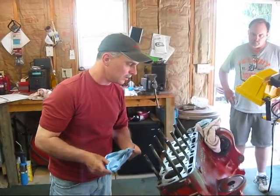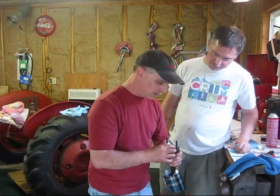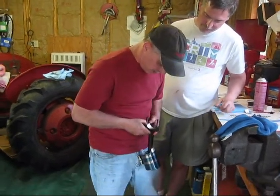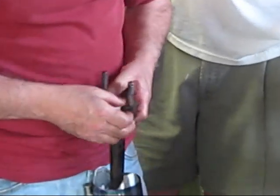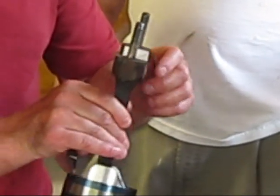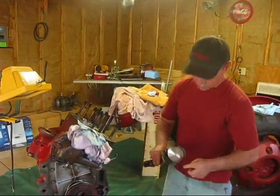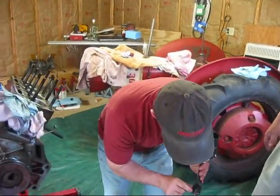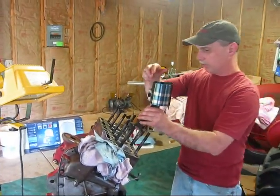We're going to oil up the rings on the pistons here shortly, lubricate them good, and put these pistons in one by one. 43 pounds of torque on the nuts for the rod, and some assembly lube. We come in here, pocket the lock, get her on there, push her down, keep them even. The crush here and here needs to be even, which it is — that one's ready to go in. Number one: the arrow goes forward on this piston, goes to the front of the engine. The number stamped in it goes to the cam side.